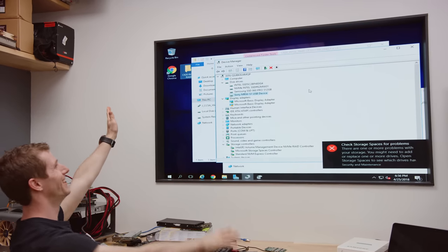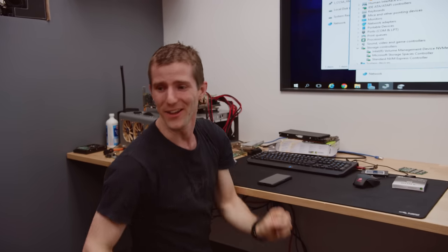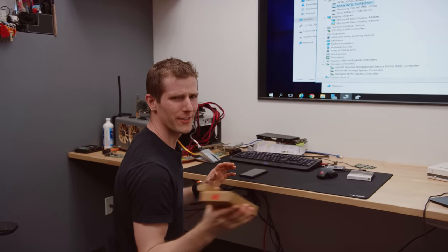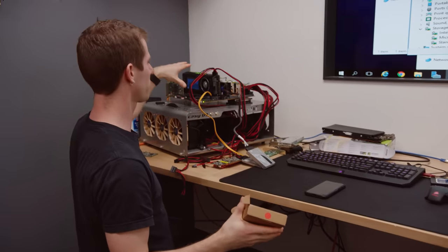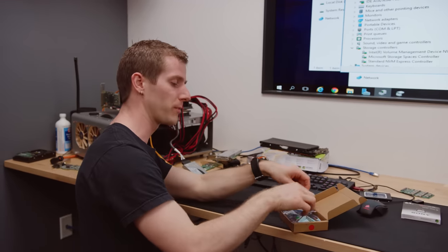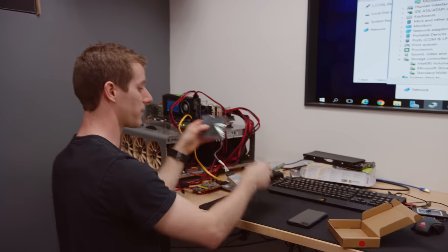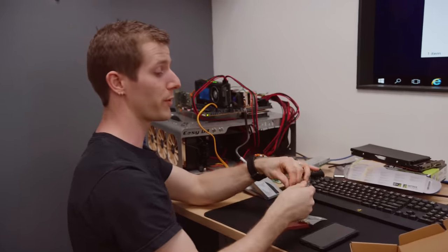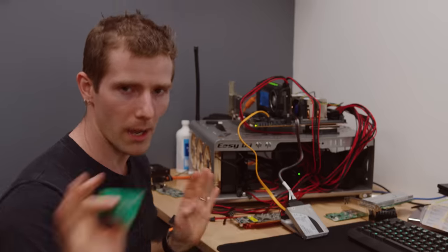There it is! But off camera, I had another idea. So, there's hot plug options in the BIOS for other PCI Express slots on this board, but ASUS has specifically told me that there's a finished system that uses this board as a base that has a special backplane that enables the PCI Express slots themselves to be hot pluggable, but that the standalone board doesn't do it. So given that following their instructions so far has been my best bet, I'm gonna take their word for it.